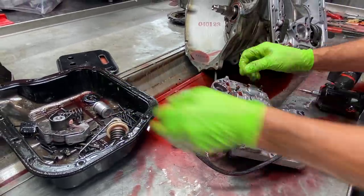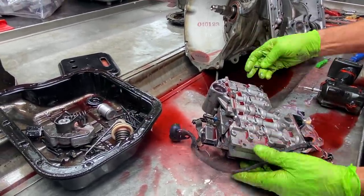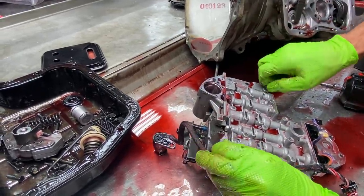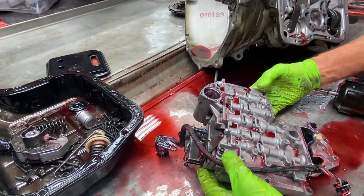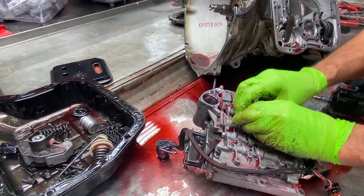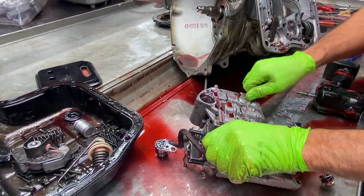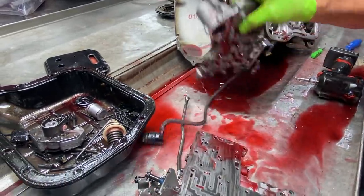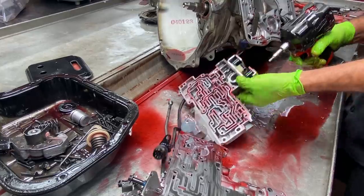And they come in the door that way from the factory, not by somebody else messing with it. So pretty simple. Now these bolts are your alignment bolts, these two right here. You want to get these started in. Get them all started, but these two I tighten down first, and then I work my way from the middle out to torque them. Pretty simple.